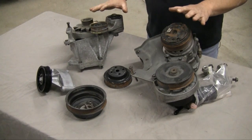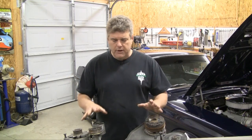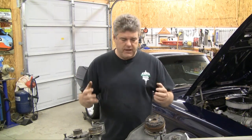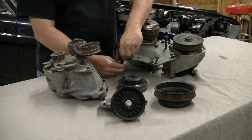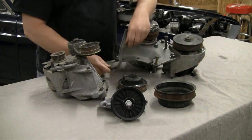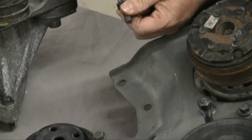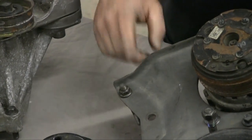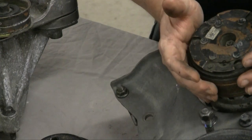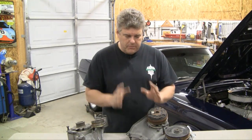Vinny's gone over how to measure up the engine bay to make sure you're getting the right serpentine system at the junkyard. The system on the table is our example — it's probably going on our 1964 Falcon. Some manufacturers were really particular about their installations. Certain bolts on this application are only for Fords of this era — this water pump bolt is actually a two-thread-size bolt. If you don't have that particular bolt, it can offset your belts, cause a squeak, and possibly throw the belt off the system.